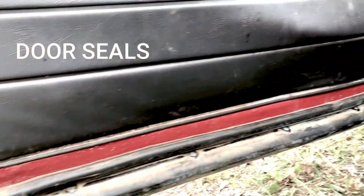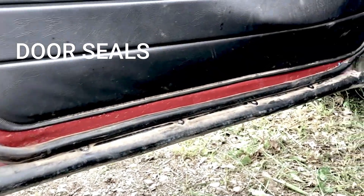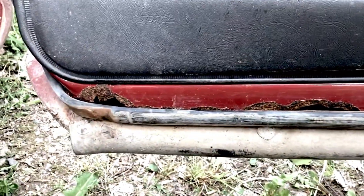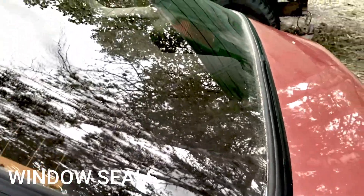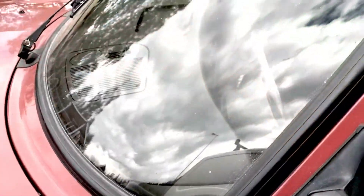The bottom of the door is very important — quite common again because water gets trapped in those rubber seals, as you can see on the rear door here, it's quite corroded. The edges of the rubber on the windows are very common to get rust coming there. This is actually quite good on this example — there isn't any rust on the screen edges.